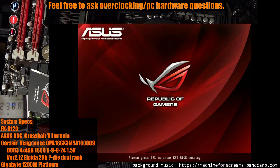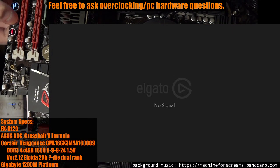Depending on what CPU you have, you won't have display output if you don't have a GPU. If I remember correctly, the main limiting factor to the memory clock on FX chips is the Northbridge clock itself, and you're not doing 3 GHz Northbridge. I think the memory's not stable. 14700K. Oh, you have an iGPU, then yeah, you can use the integrated graphics, as long as your motherboard has an HDMI or a DisplayPort output, then you should be able to use that.